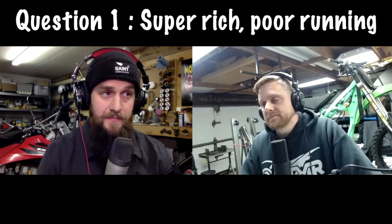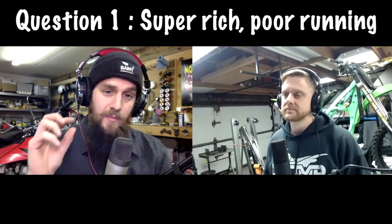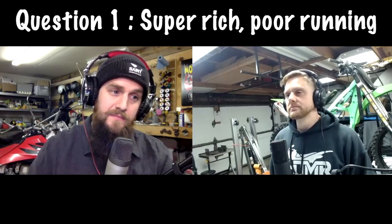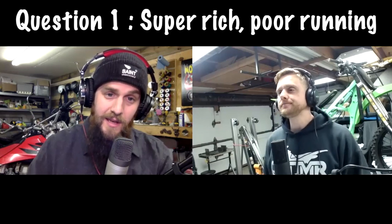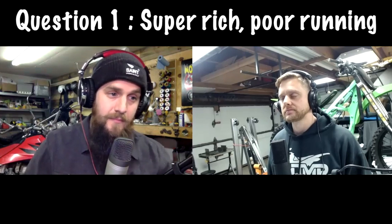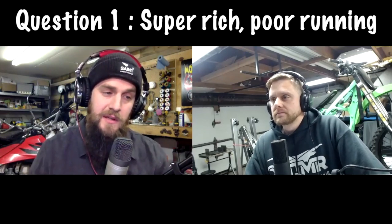So wrapping this one up — the front cylinder being rich — he should check the main jet sizes, make sure he's got the right one in the right port. Then double-check the rubber CV diaphragm inside the carb. Make sure the CV is not locked down or doing something wonky. Make sure the main jet is tight, because they can fall out. Make sure the needle valve for the CV piston is in there tight — if it's not, the jet can do whatever it wants and make it super rich. This is a carb thing, not a valve thing. He most recently messed with the carburetors, so let's go after those. Matt and I both have videos on that.